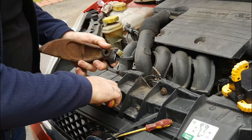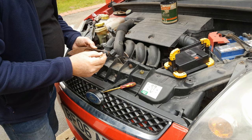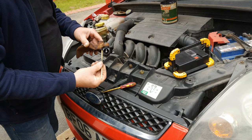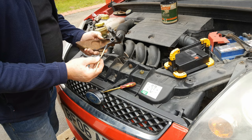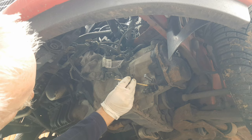First, remove this ball joint receiver from the ball on the end of the gear change lever — I'll show you what to do with that in a few moments. Apply a little lubrication to the inside of the bush using a high quality, high temperature grease. I'm using moly grease here, also known as CV grease. You could use Ceratec if you've got some left over from a brake job. Also put a little bit around that ball joint and into this ball joint cup. Keep your grease handy because we'll be needing some more of it when we're underneath again.